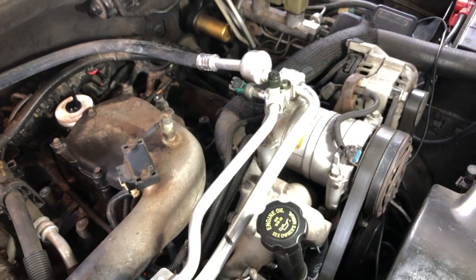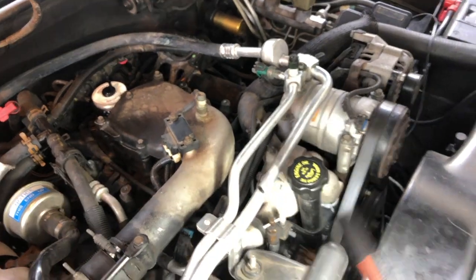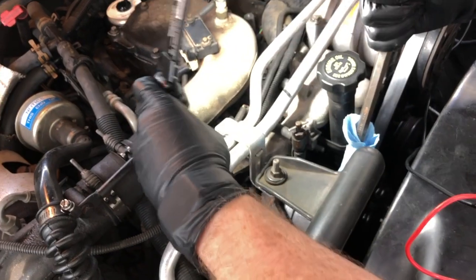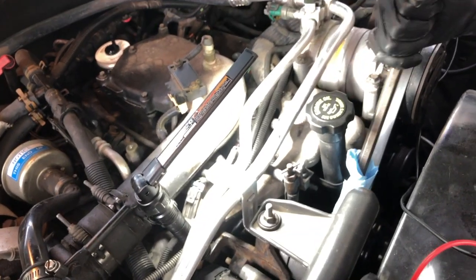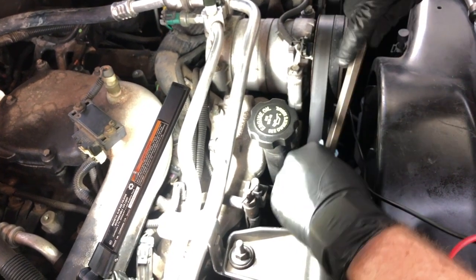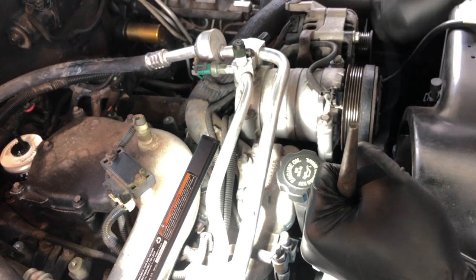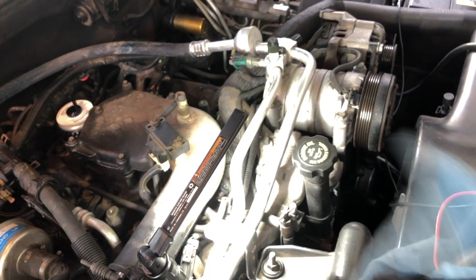I'm going to take this serpentine belt off first. I'll show that because I've got the tool handy. I'm just going to take a kind of crowbar tool, and I've wrapped it with some paper towels so that I don't damage anything. Still hunting for something magnetic here for the flashlight. Everything's aluminum. Never can get this guy where I want him. There he goes. I should pry him up, be able to get the belt off. And I just use this so I don't get any scratches or mars on the pulley itself.